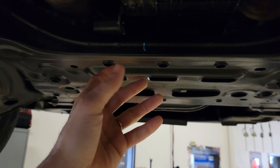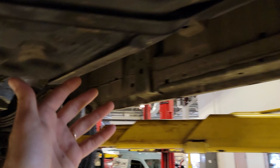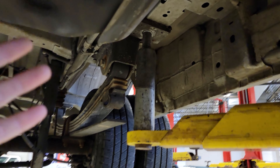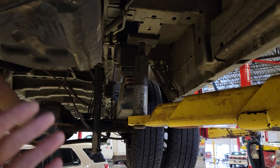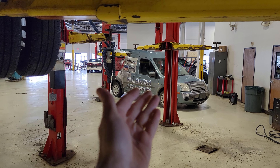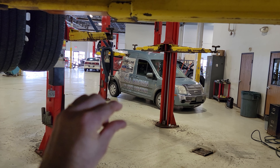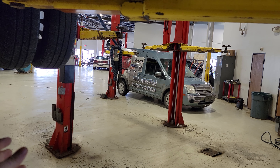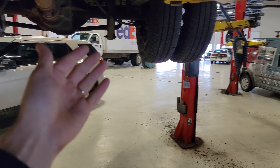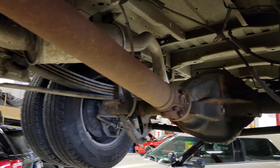We need to be safe and cognitive of how we're lifting these things — we've got thousands of pounds dangling over us. Don't be that guy doing silly stuff. When you lift the vehicle, get it off the ground a few inches. My thing is: get it floating just an inch off the ground, come around, make sure all the hoist arms are set, everything's good, give it a quick jounce, everything checks out, then lift the vehicle up.